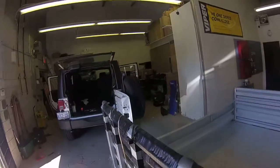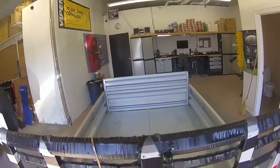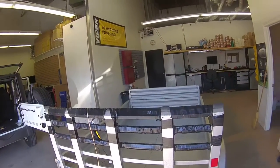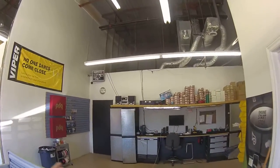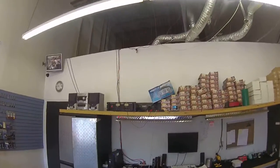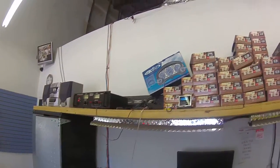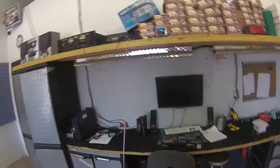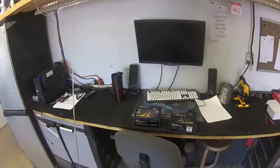Basically it allows you to install the camera, which I've temporarily mounted right here. I've connected it to the trailer and run this speaker cable to my power supply, but in a regular installation you could wire it to the clearance lights since they're on all the time, and plug it into the wireless video transmitter right here. That allows you to transmit the video signal wirelessly up to 200 feet to your screen in the front of the vehicle — cutting down installation time, reducing potential install issues, lowering material costs, and allowing you to install cameras in situations where you normally may not be able to.